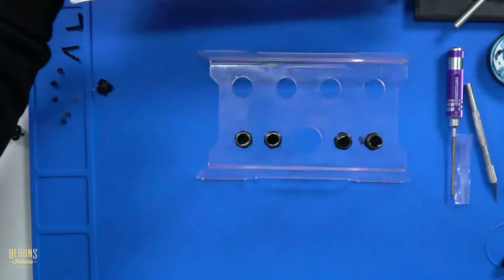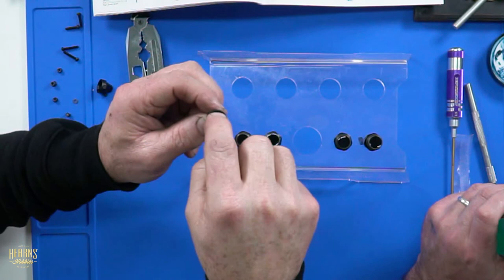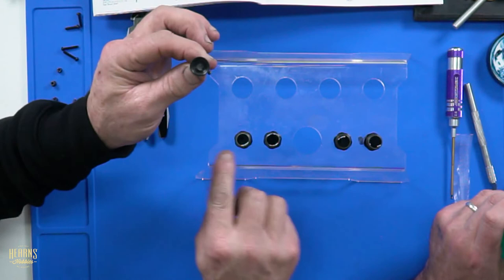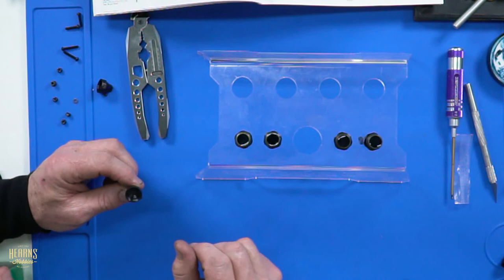Wheel bearing grease? Yep. Add half weight. Now, when you have a brand new shock, do you pre-oil them too? No. I actually put a dome of oil on the shock, because of the volume of the cap. If your oil's level with the top of the shock, it doesn't have enough oil to fill the cap, and you'll end up with a massive air bubble in the shock. Then the car will be really inconsistent.